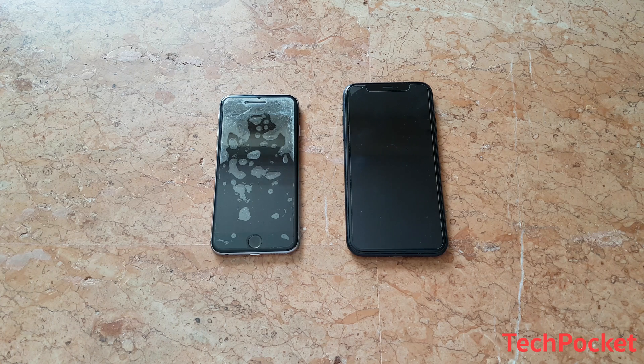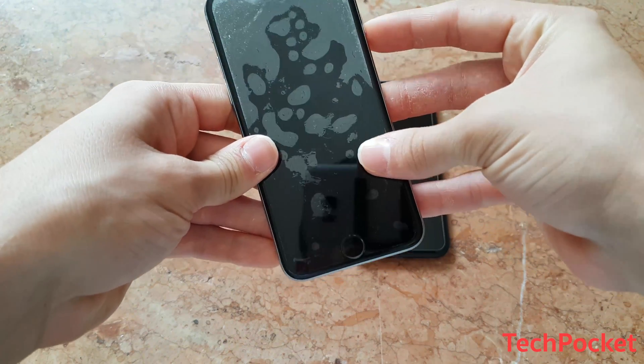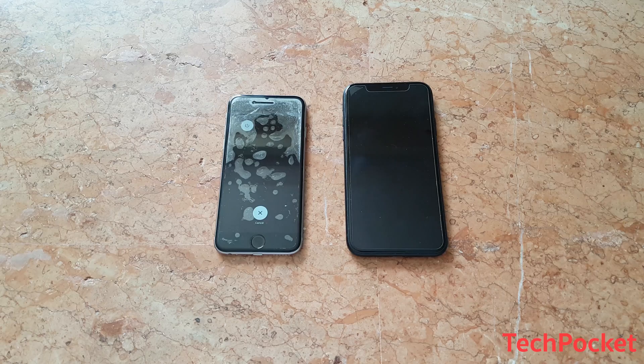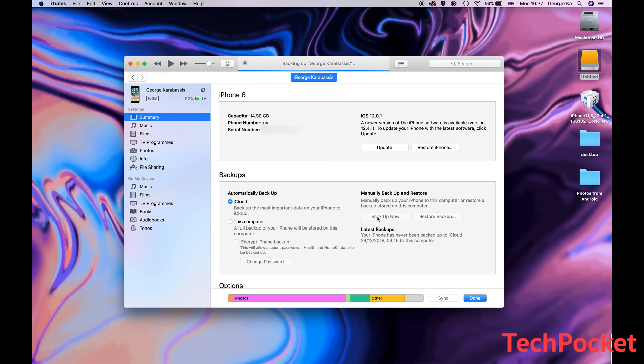A very slight note is that sometimes you can still back up your phone and all your data even though your phone is locked. That will only happen if you have unlocked your phone at least once since you switched it on. So for example, if you power off your phone and switch it on again, you won't be able to back up immediately — you're gonna have to unlock it at least once first. So go through iTunes and connect your device, then click on the iPhone icon and go to where it says backup now. If it doesn't let you back up and says your phone has to be unlocked, then unfortunately you won't be able to recover your data.